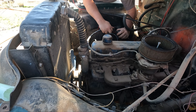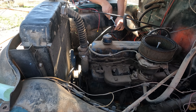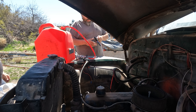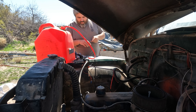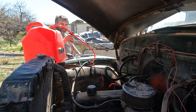Ballast resistor now has power. Okay, hit it. Yep, it's got spark — I didn't see it but I felt it. I have a feeling it's got spark. Now let's hook up our fuel system. It runs! Maybe put some water in the radiator. Did you put the clamp on? I still forgot to put it on. We'll have to put valve cover RTV on it — yeah, it's leaking too. I don't know about y'all but I really am excited about this — this is Project Sullivan's version of Will It Run.